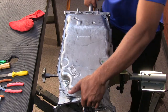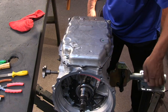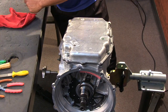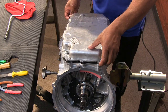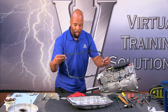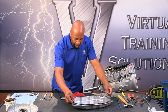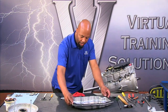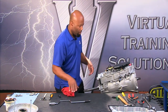Let's go ahead and rotate this into an upward position and lock this in. We're going to take the pan off because we need to take the valve body out. We'll remove these bolts and pop the pan off — there are 15 bolts on this. Notice that we have a rubberized gasket, a pretty thick gasket, with locators that allow us to locate it on the pan as well as on the case. Very straightforward — something that General Motors has been doing for a while.